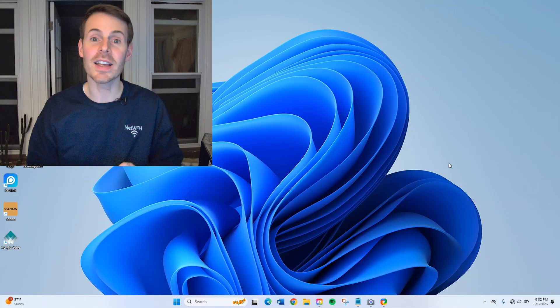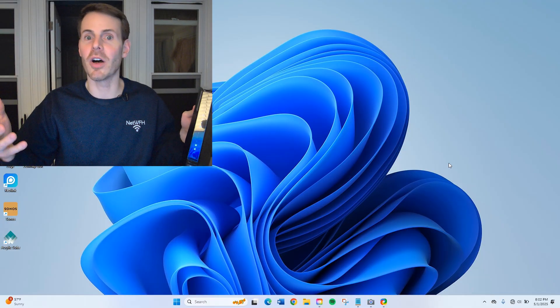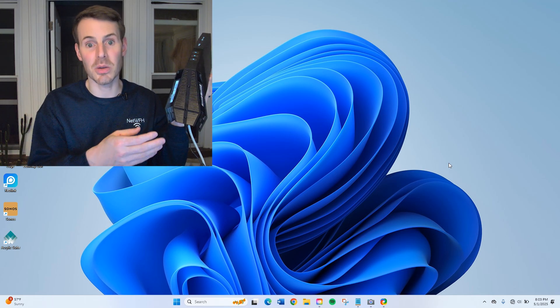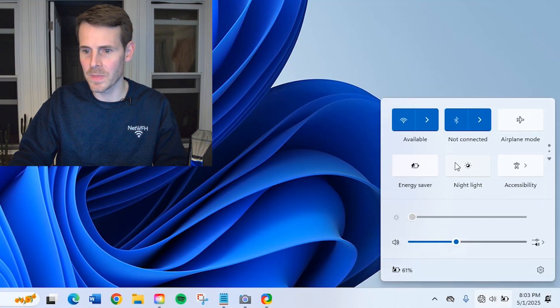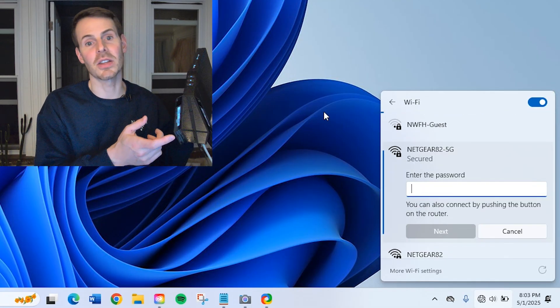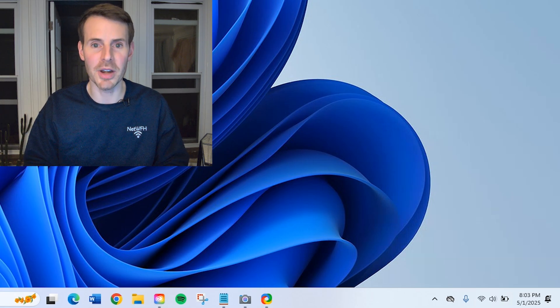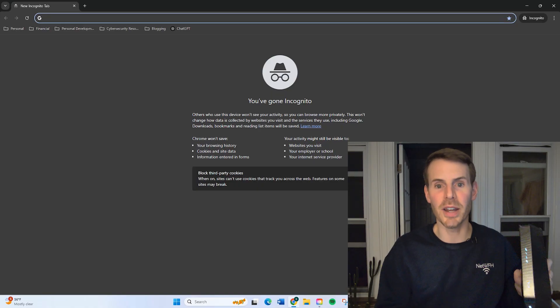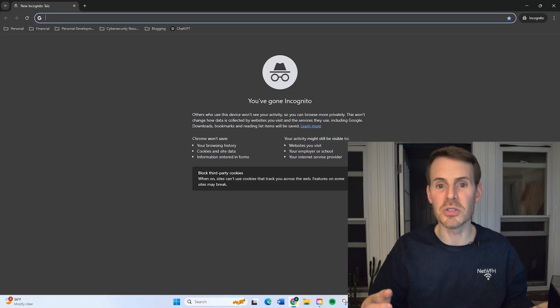Our lights have reached steady state and our device has restarted. Now we need to access the settings for this device — I'll show you how to do this on my laptop. The first thing we need to do is connect to one of the Wi-Fi networks of the modem-router combo device. It says right here on the side 'Netgear 82' is the name of the default Wi-Fi network. You can find this information on the bottom of the device, on a sticker on the side, or in the user manual. Let's connect to the 5G network, enter the default password from the bottom of the device, and once connected, open an internet browser and go to routerlogin.net to access the settings.